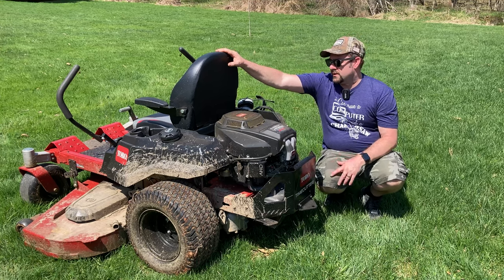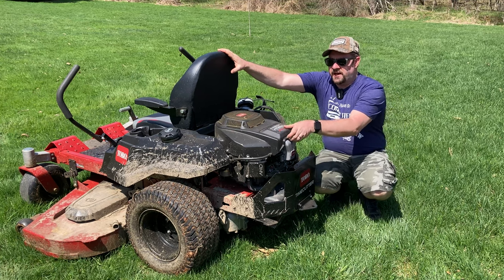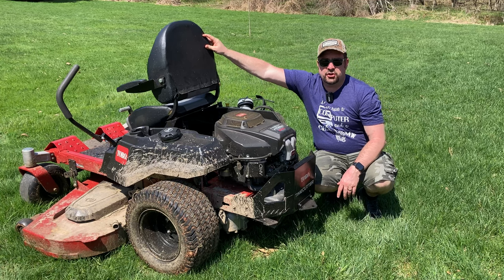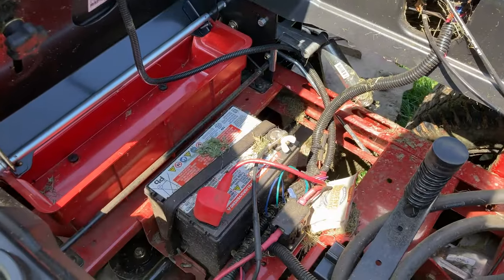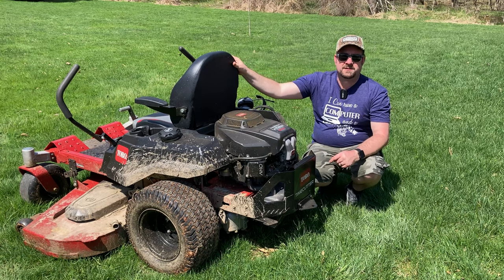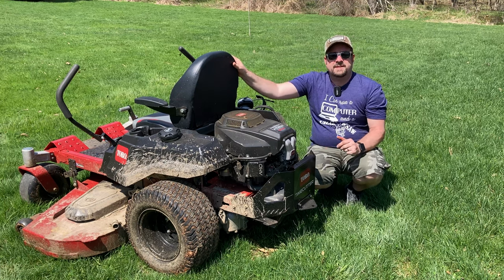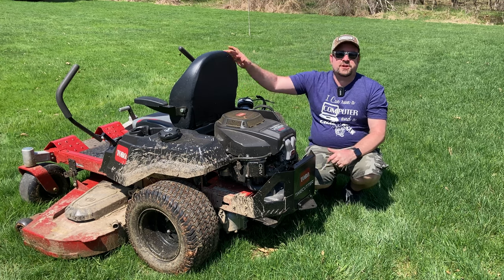In addition to changing the oil and checking all the air pressure in the tires, some of the things I like to do before the start of each season is change out the air filter on this Toro Time Cutter — it's really easy to get to right here. Another thing I like to do is make sure my battery is in good working order. I leave this on a trickle charger all winter long so that it stays good. The battery is pretty important to making sure you don't have misses. If you've got a weak battery, a lot of times it's so inconvenient to have to charge it or jump it every single time that it's better to just change out that battery for a fresh one, so every time you come out and turn the key, this machine is going to start.